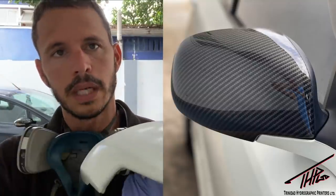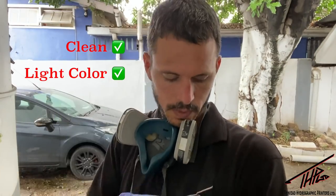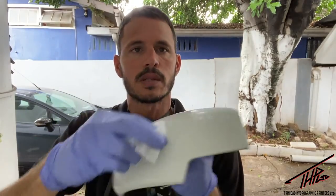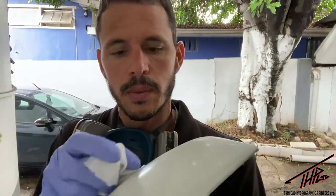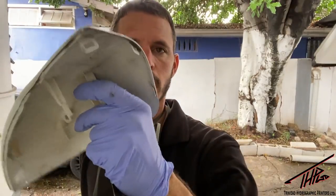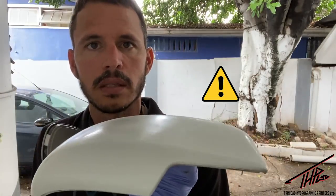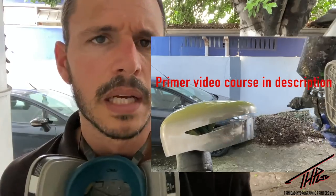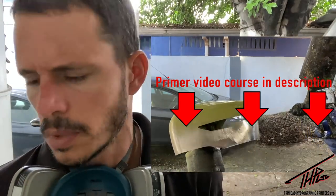The first step is to use a cleaning solution and a clean cloth, preferably a light color or white, and you want to use the cloth to clean your parts with. You've got to designate your right hand if you're right-handed to clean with, and your left hand to hold underneath the part. Under here is contaminated so you never want to switch hands because then you will get the contamination on top. Designate one hand for prep — that's your first most important tip. Otherwise you're going to get fisheye and you wouldn't know where it came from.